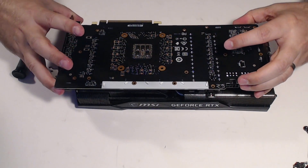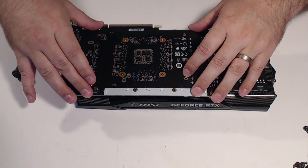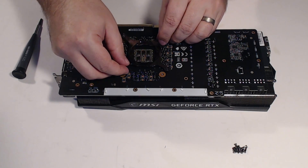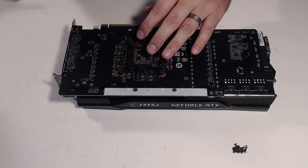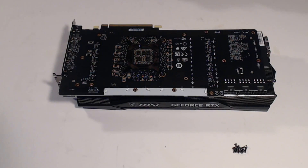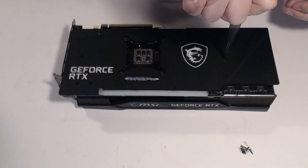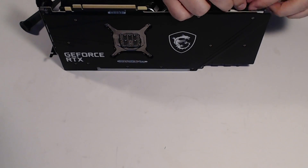And that's your teardown — hope you enjoyed that. Now it's time to put the thing back together. Just line up the holes and we'll reverse the order. We've got to do the center GPU mounting bracket first — looks like it's actually a rectangle, so I had it backwards. Get it in the right position and go ahead and screw it down. Putting it on is a little more difficult since it fights back against you, but just do the little X pattern as you tighten these, then we'll move on and get the back plate back on. This one's not as hard — you're not fighting any springs, just the thermal pads. Once that's done, all that remains is hooking up the fans and we're done.